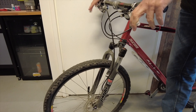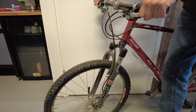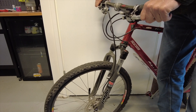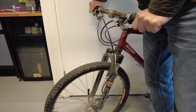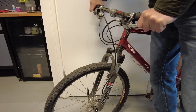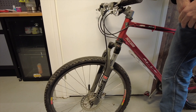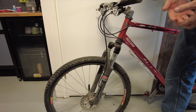Let me use the bike to illustrate this. Preload is simply the starting point at which your suspension is going to start working or activating based on the weight that's applied. This particular fork has been set up with the weight of the bike in mind, so this is its zero point for preload. If I compress this — because I'm changing the weight applied — that's your preload point. This actually reduces your amount of suspension travel but doesn't necessarily change the spring rate. The rebound is simply the speed at which it returns back to its zero point for preload. With the Mini, it's been calculated from the OEM point — the total weight of the car — and that's its starting point for preload. By adding more weight, I'll be changing that point, effectively reducing the travel.